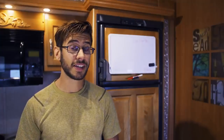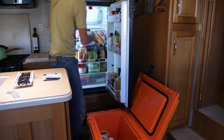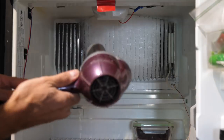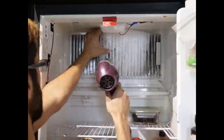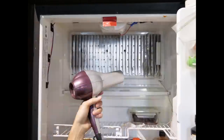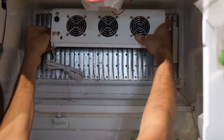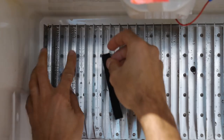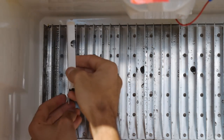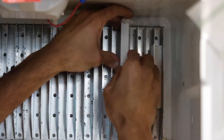I found the installation of the fan kit very easy. We started by removing the food from our fridge and putting it in a cooler, then defrosted our heavily frosty fins by shutting down the fridge and using a hair dryer on low to help melt the ice and pull it away from the fins. When defrosting, don't use too high a heat directly on the fins because you don't want to warp the metal. Once defrosted, we test fit the fan unit to the fins to figure out which fins it needed to be attached to. This unit uses velcro to attach to the fins, so you want to make sure to dry and clean the fins first. We attached the velcro to the appropriate fins, placed the brackets that hold the fan units on the velcro, and then clipped the fan unit onto the brackets.